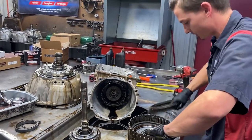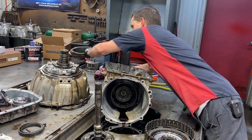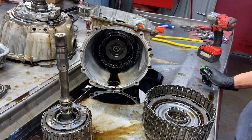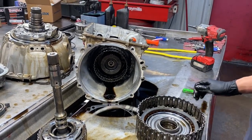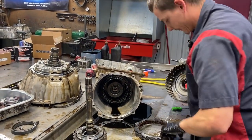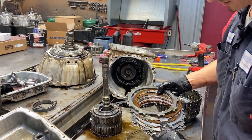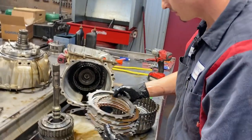They do make selective snap rings in different thicknesses - when you change clutch packs to thicker or thinner, you have to set that up correctly. Always keep your snap rings with your clutch packs on these units. Almost every unit we do we have to change snap rings - we never just throw them back in. We actually set all our clutches. We bought a bunch of snap rings from TransStar through Raymond over there. Our 1-2-3-4 clutch isn't looking terrible either.